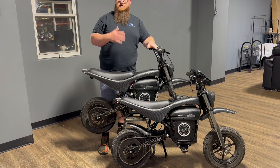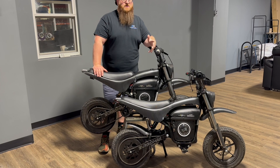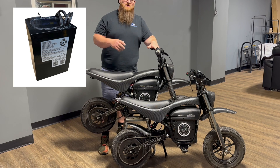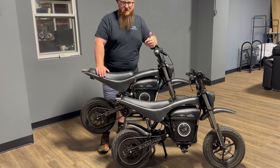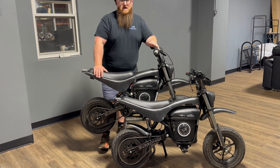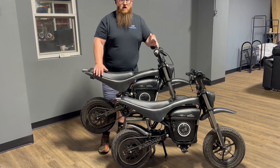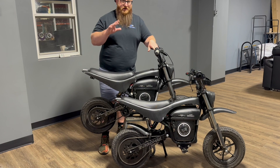One last thing — just to touch on batteries. Batteries are pretty straightforward. The hardest thing is actually getting one because they're so rarely available. As far as battery dimensions, we have one that fits really well in the stock tray. You have to modify the top of the metal bracket a little bit and cut some plastic, but otherwise it's perfect. We'd love for you to use our 72 volt battery, but you're free to use any 72 volt battery you want. Just make sure you get one with good specs — look at your amps and your amp hours. I'd say 100 amp minimum, and 20 amp hours will do it unless you're really hardcore. The larger the amps and amp hours you go, the larger the battery, and the harder it will be to fit. 100 amp, 20 AH in the right shape works really well with these bikes.